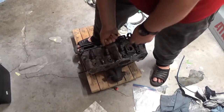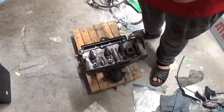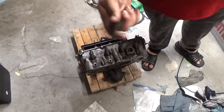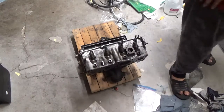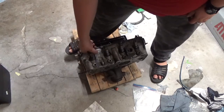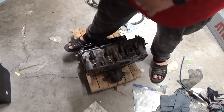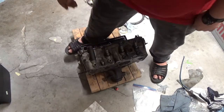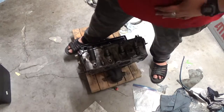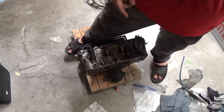Pull your lines off. I'm going to keep the rubber tip on. And if your hoses are good, you know, mark them. If they're not, of which ours are not, and that's why it's getting new hoses. Now, this is the proper injector, 27 millimeter injector socket. These are torqued into the head at 52 foot-pounds. Okay, that is what the book calls for specification-wise, is that these be torqued in at 52 foot-pounds.